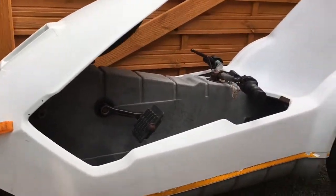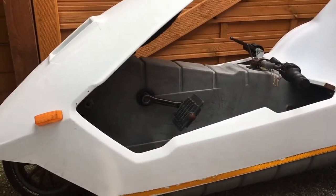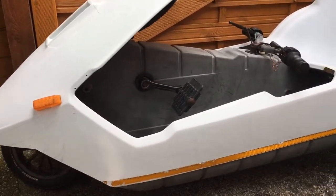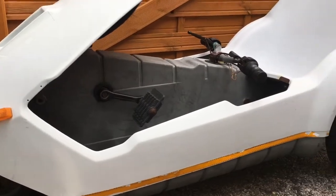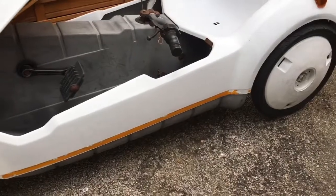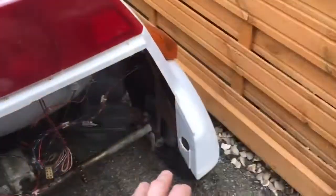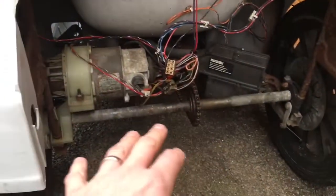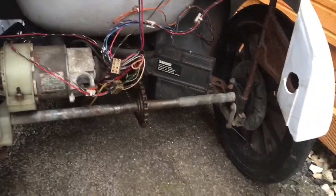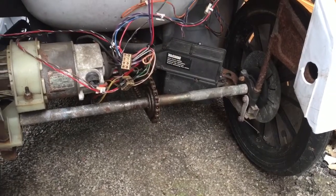So what I'm going to do is, the guys have cleaned it. It looks pretty decent. Obviously it's faded loads in there. If they want to do some sort of Teflon or silicone or paint it, you know, plastic paint, they can do. But what I'm going to do is replace the side stripes on it, clean everything in terms of all this aspect around them, all the mechanical aspects. So give this physically a good clean, and then take all the brakes apart, service all the brakes, make sure everything's sorted, replace the cables if they need doing or if they're in any manner suspicious.